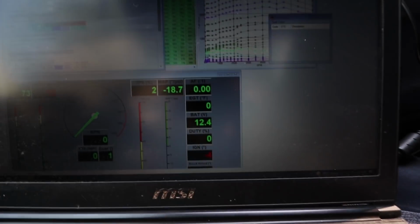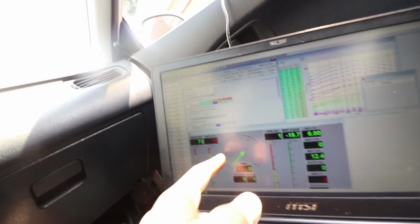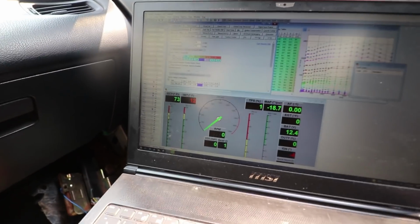I don't know if it's the sensor. See, like this says sense. That's reading 0. That's strange. So intake air temp, we gotta figure out. I got a pretty quick and easy fix for that though. Starting off with all these electrical issues was discouraging to say the least. Narrowing it down to just 2 sensors though, did make me feel quite a bit more optimistic about the situation.